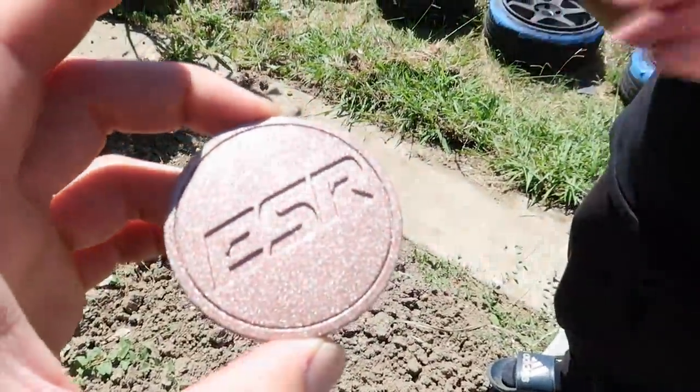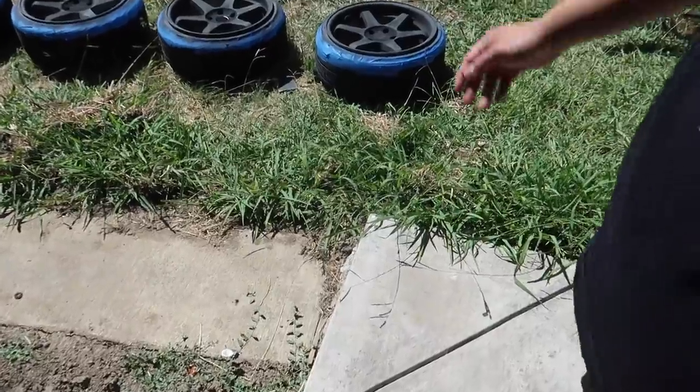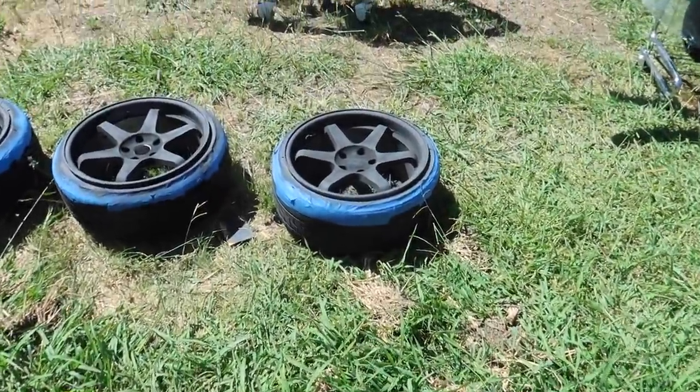Should I wait? Because when I wet sand it, it's really fast, because the 800 grit, when it's wet, you know it's just bumpy. Well, yeah. Once you hit it like once or twice, it's already smooth. So you just go like this real quick with your wheels, done. All right, makes sense, we'll do that. But I don't know how long you should wait before you wet sand it though. It's pretty dry already. It's quick dry to handle, but not to wet sand, yeah?